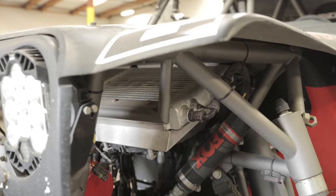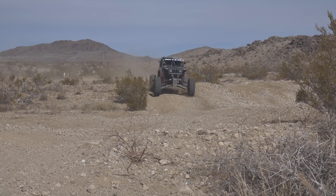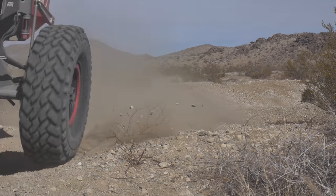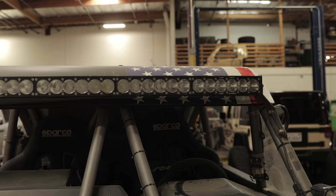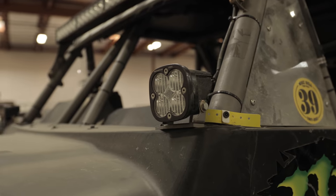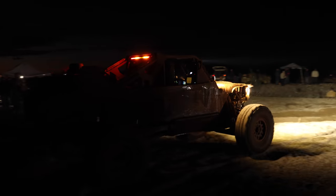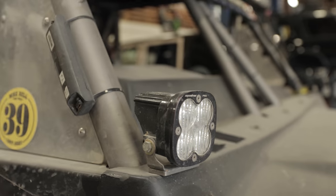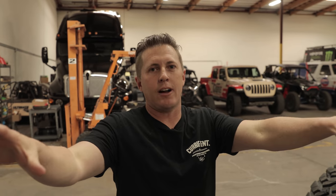In the front underneath is a CBR tranny cooler. Being four-wheel drive it's pretty easy on cooling because of the low RPM and load, which keeps everything cool easily. We've got the Jeep JL hood and grille, everything shrunk down. We do a Baja Designs light bar across the top and two lights on the A-pillar to light up the sides on tight roads — the two LP9s shoot straight forward, the light bar gives a horizon, and the two side pillars help focus on rocks on the sides.